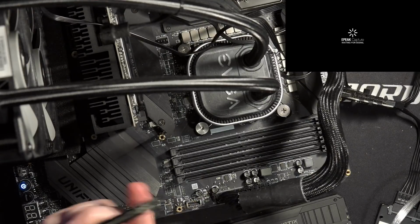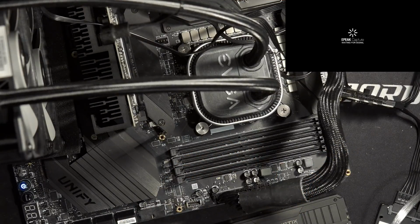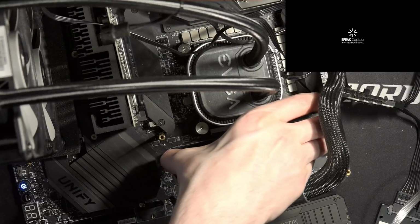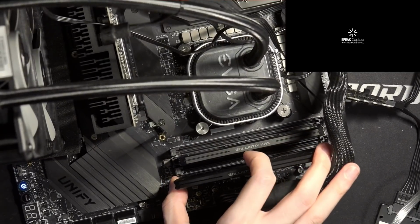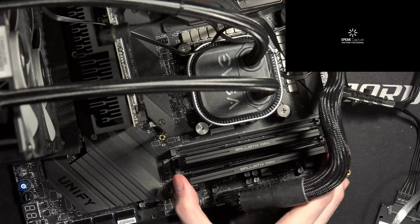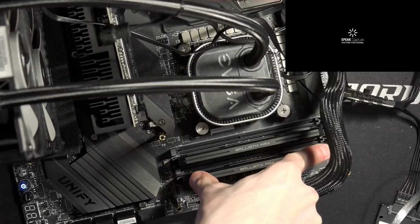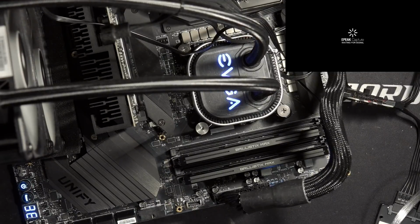Anyway, let's move on to the also single rank Crucial memory sticks. Wait, are they? Yeah, they are. Crucial just has foam that looks like memory chips. I mean, we'll know that they're single rank when you see the Linpack performance, so don't have to be too worried about that. Technically speaking, if you already have memory sticks installed in your system, you can check how many memory ranks they have with CPU-Z. But checking how many ranks your memory has after you've already paid for it is kind of counterproductive, in my opinion. At that point, it's a little bit too late to be worrying about what it is you actually paid for, right?